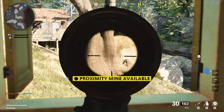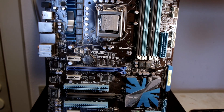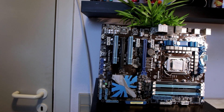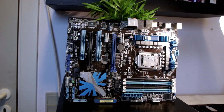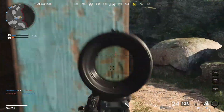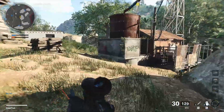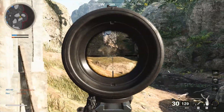Let's get into the test setup. I'm using the Asus P55 motherboard with 8GB of DDR3 memory, as that was a little bit more common at the time. We're also using a GTX 970 with a custom BIOS running at around 1450MHz. We are using Windows 10 as of recording this video, and we will also do a quick overclock on the CPU — back then you didn't need K-SKU CPUs to overclock, you basically just turned the base clock on the motherboard, and I was able to achieve 4GHz.